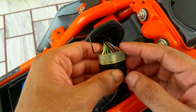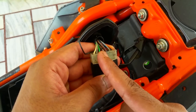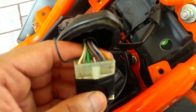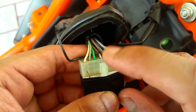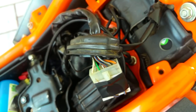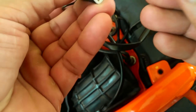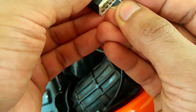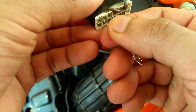We're only interested in two wires: this green one and the gray one — the second and third from the left. The green one goes to the right indicators and the gray one goes to the left indicators. What we're going to do is take the diode setup and put them right into the gray one and the green one, like this. Make sure it fits all the way in — it's a female connector and it's supposed to go right into it.